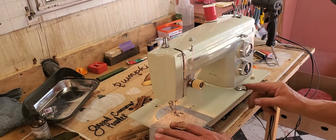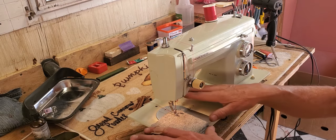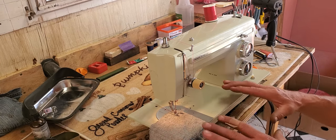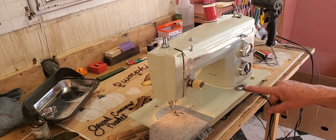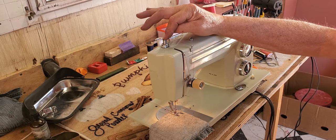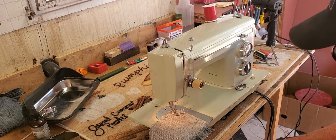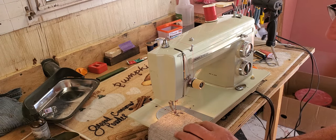So with the feed dogs in the down position, and the pressure off, then you can move the fabric around. And to do that, you'll probably want to get an embroidery hoop or something to keep your fabric taut while you stitch. But for regular sewing, up position for the feed dogs, and you're going to want to press this down about halfway. Halfway is average for average fabric, like cotton shirting, light denim.